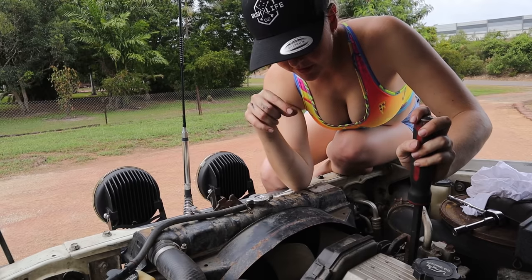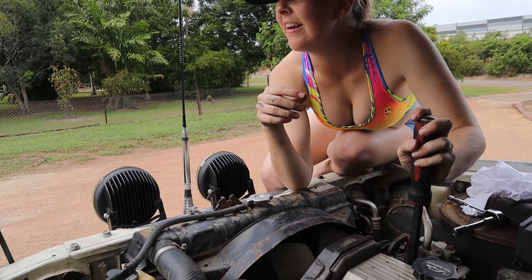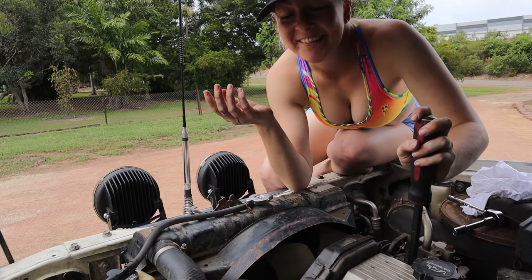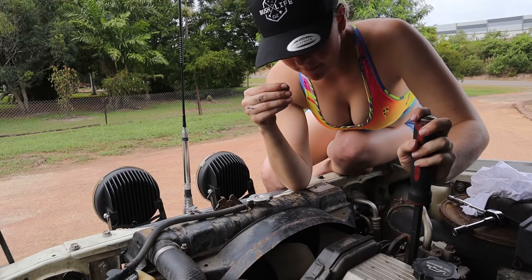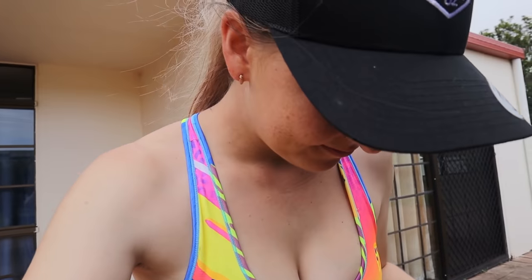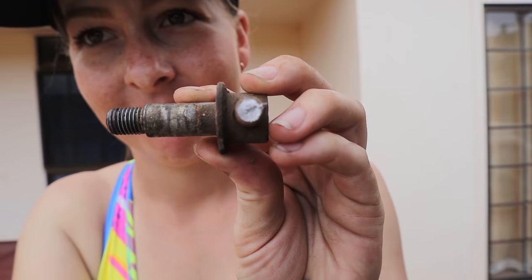The adjustment bolt and the locking bolt for my alternator are broken out as well, so I'll get one of those. All I'm doing is levering the alternator out, which tightens the belt, then nipping up the locking bolt. So this was going to be a what's-in-my-Land-Cruiser video but it's kind of turned into more repairs and now I'm covered in stuff again. That's my air con adjustment bolt — it's just not gonna work.